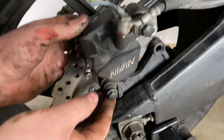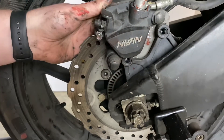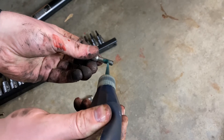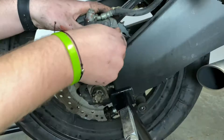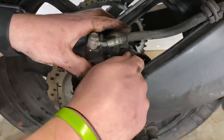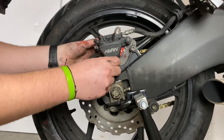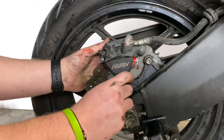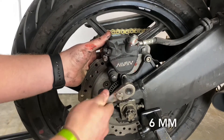I'm going to start working on the brakes now. I get my pads over top of my rotor and I like to use a little Loctite on the brakes to make sure everything's good. I tighten down my brake pad pin and put a little Loctite on that as well. Now I'm going to tighten down the caliper bracket bolts and tighten that down to 25 foot pounds of torque.